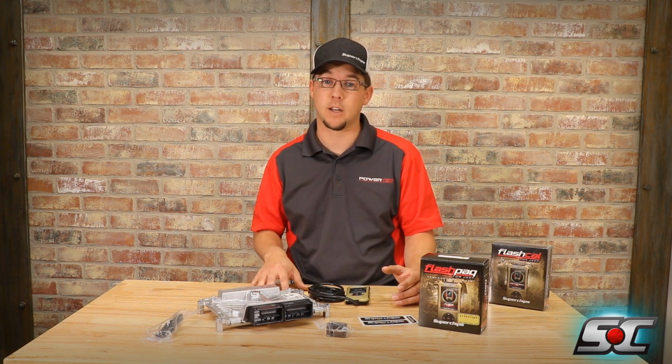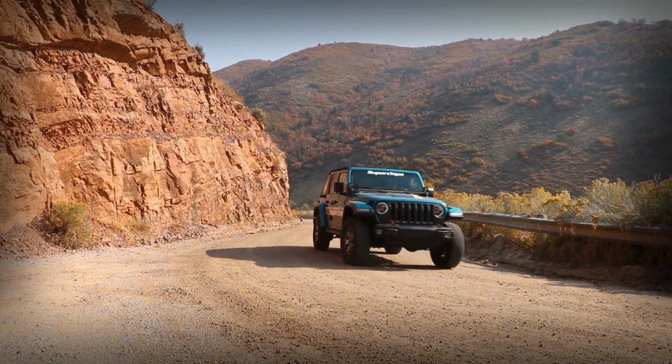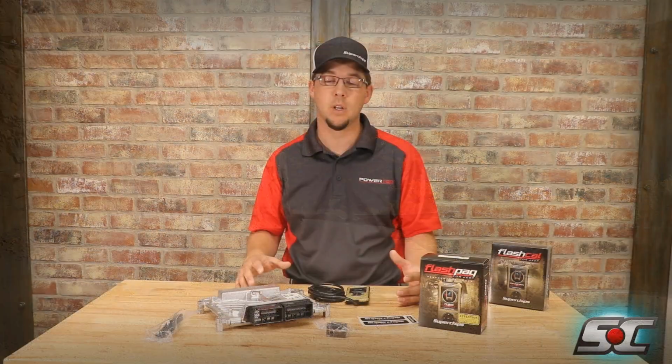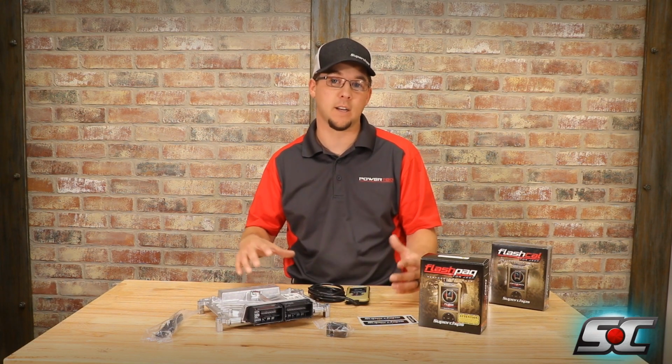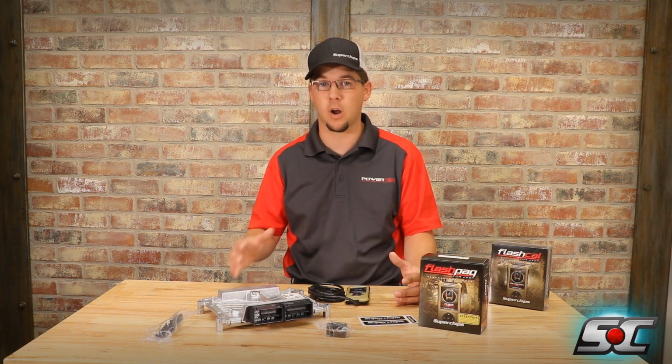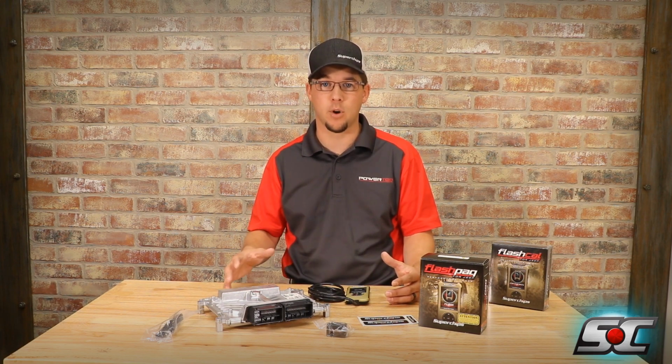For you guys that spend a lot of time off-road, we've obviously continued on with our Jeep tuning structure, and we've added a specific crawl tune where we've been able to manipulate that throttle pedal. We've been able to manipulate that boost curve so that you have a nice, easy, drivable tune that works well in loose, hard to get traction kind of dirt, rock crawling, whatever it might be. We can really fine tune how that Jeep drives when you're off-road.